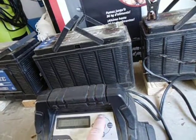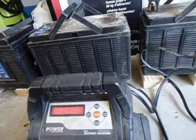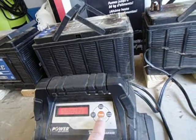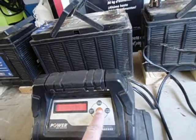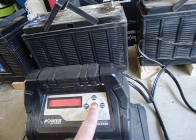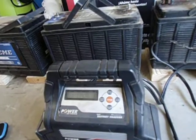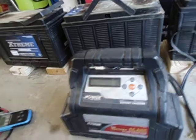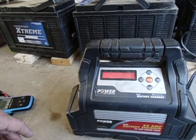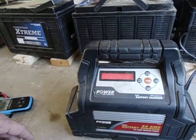Right now we'll go to battery voltage and now it's indicating 14.6 volts. I don't hardly believe that. I've had it on the battery recondition mode for a little over 24 hours. Let's push charge. We've got a flashing warning saying internal open cell or sulfated condition.